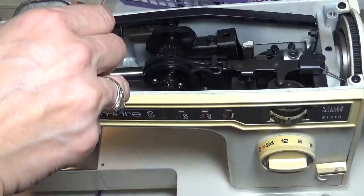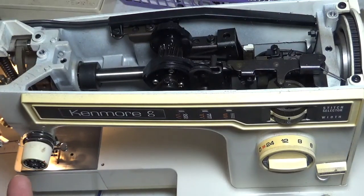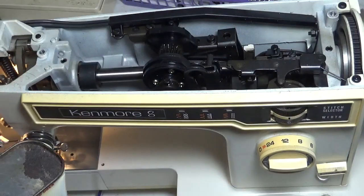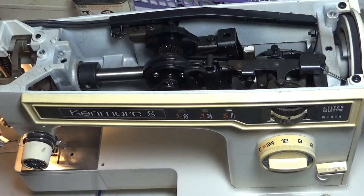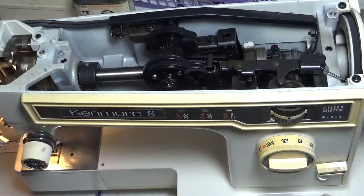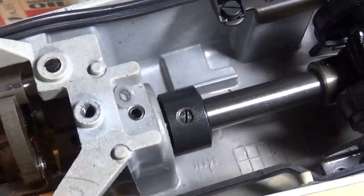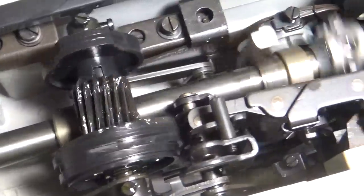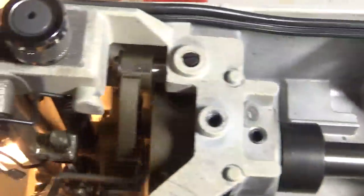The places that need to be oiled here — there's one. And where these gears are. I like to distribute the oil by stepping on it. And right in here, and also right here. Here and there — all the moving parts. So we have a well oiled and clean machine. I'm going to press the foot pedal so you can see all the parts moving. The well oiled machine is a good working machine.